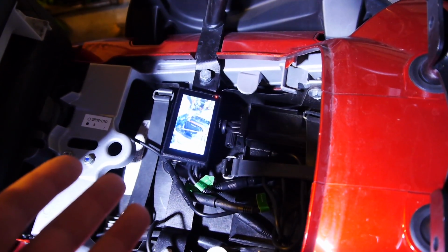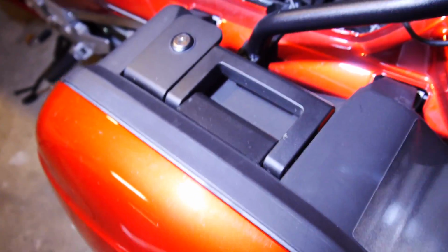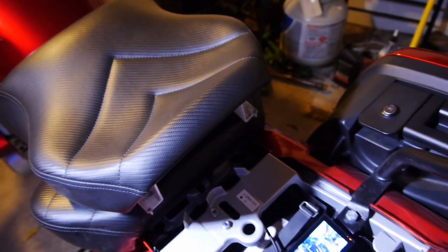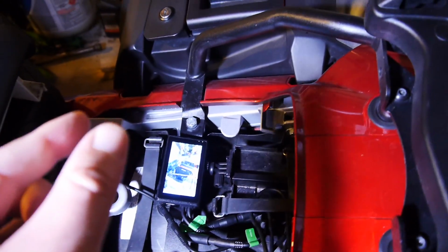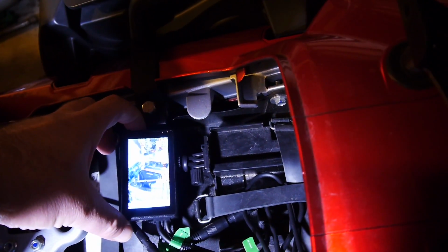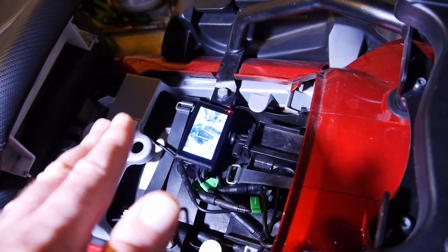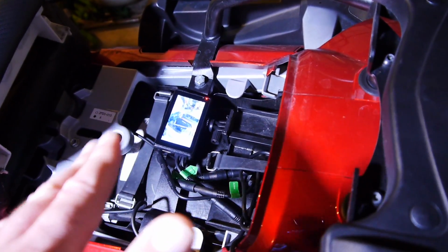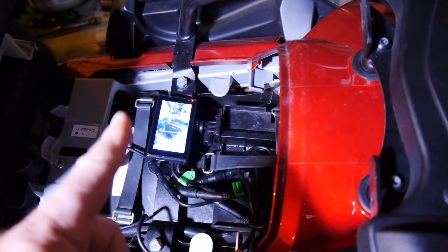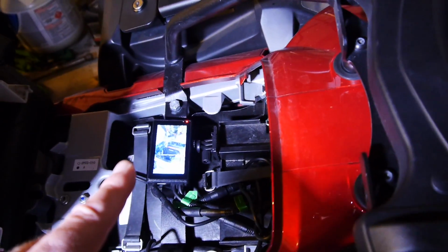So, why isn't it working for the lighter impacts or somebody getting on the bike? It is not tripped by motion, by the way. I was bouncing on the bike and absolutely nothing happened. It is a sharp impact only that trips it. The problem is they're using one setting. To fix the problem, you need 2 modes for impact detection: one while off, which needs to be very sensitive, and one while normally recording.